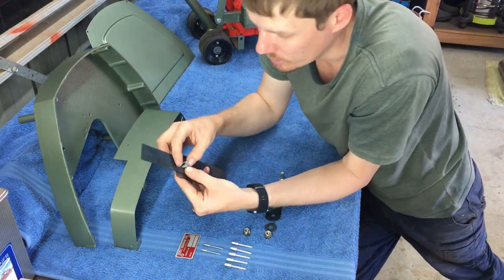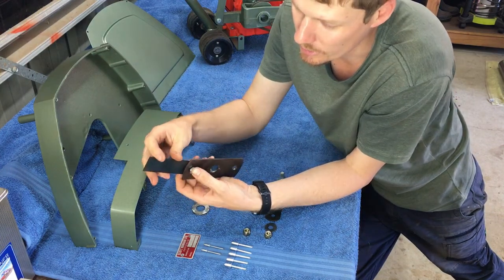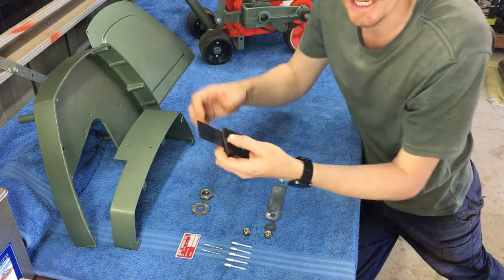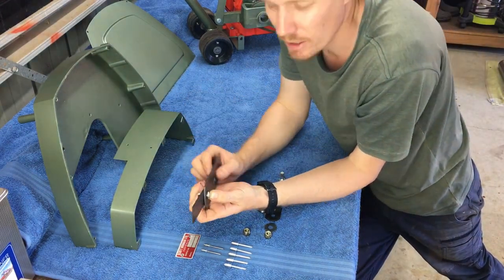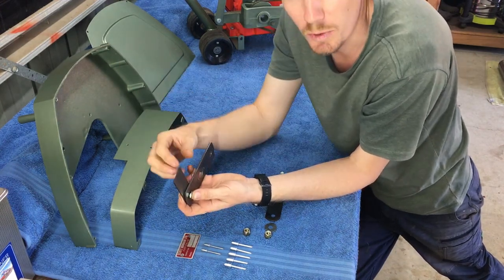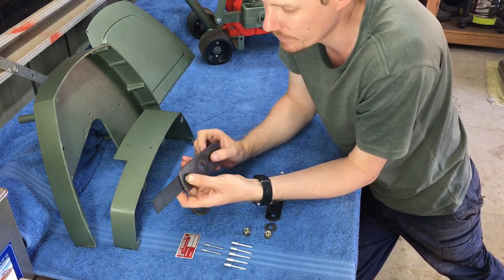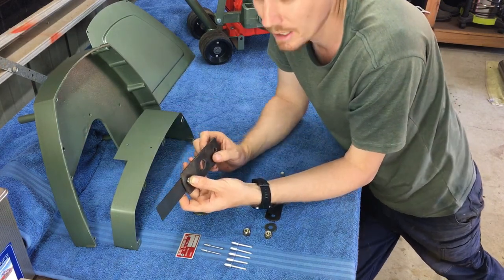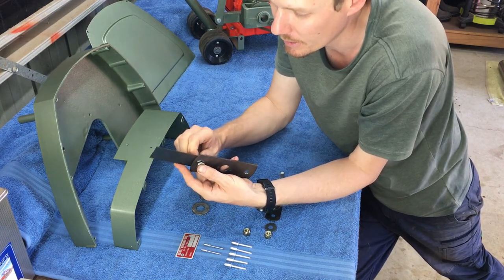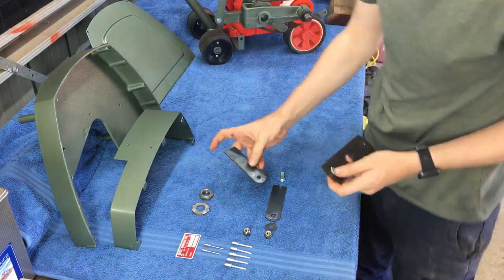When you put the flat washer, and then your nylock nut, that actually allows the blade to freely pivot. So basically, if you're cutting along the edge and you go straight into a rock, it's designed so that the blade will actually bounce back, continue to spin, and then as you pass, it'll straighten back out just with the centrifugal force. So they're designed to do that. It's a very good concept, hence why they've been around for so long. So here we go.